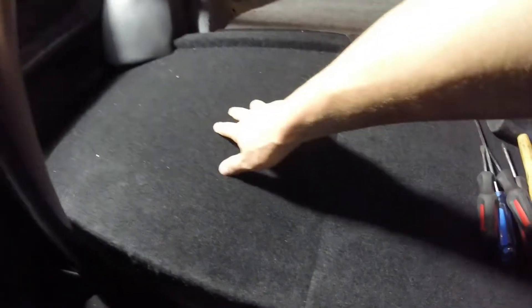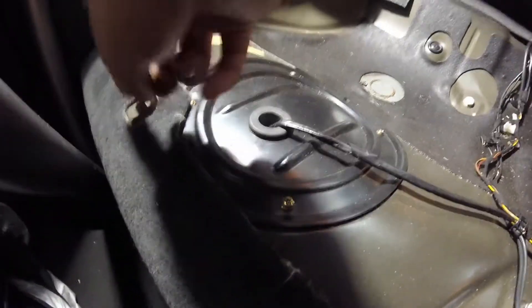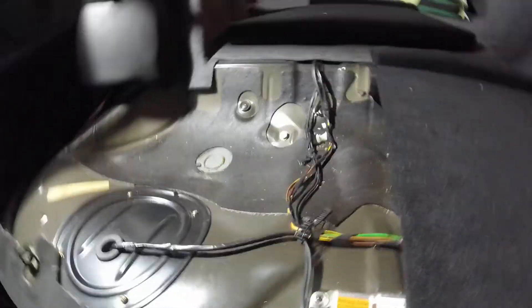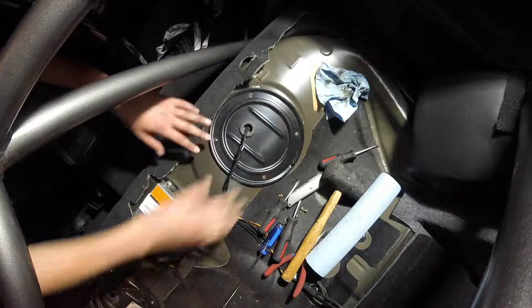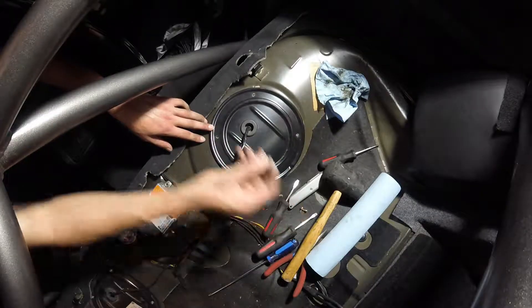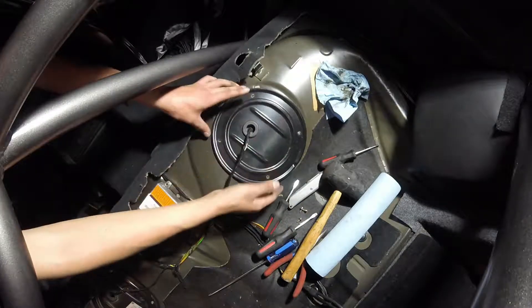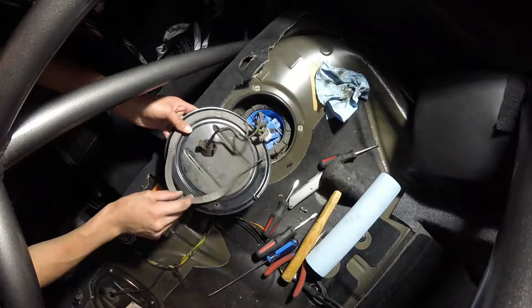The fuel pump is located behind the passenger bench, passenger side. I've done a rear seat delete so I just need to take these panels off, but the OEM bench is just friction fit to a connector on each side — you just pull it and lift it off. Now that you've removed the bench and have access — by the way, this looks exactly the same on the other side, so you can do both at the same time. Remove the four screws with a Phillips head and that will release the top plate. There is an O-ring on the inside — you can just push it up the harness. Make sure that stays, as it helps keep fumes in.